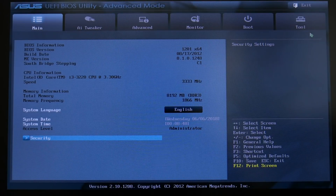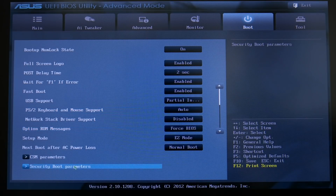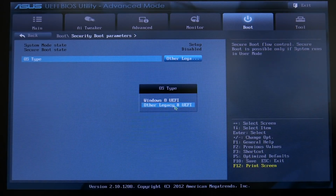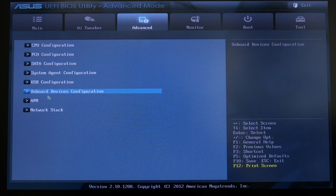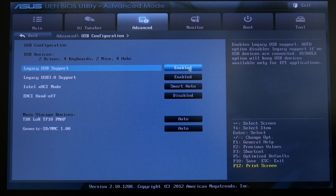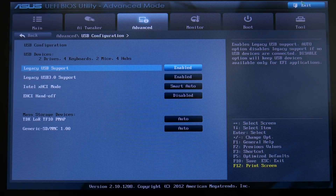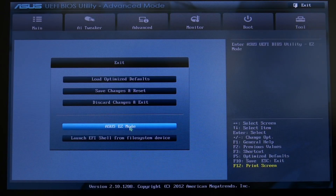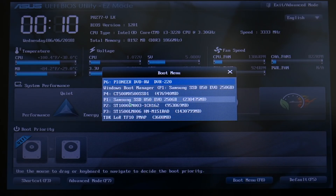For an ASUS motherboard, go into Advanced Settings. Secure Boot is in the Boot section — scroll down to Security Boot Parameters. I have 'Other Legacy and UEFI' selected. Then go to Advanced, then USB Configuration, and enable Legacy USB and Legacy USB 3.0. Head back to EZ Mode, click the Boot Menu, find the Crucial SSD — 'CT500 MX' — and click it to boot.